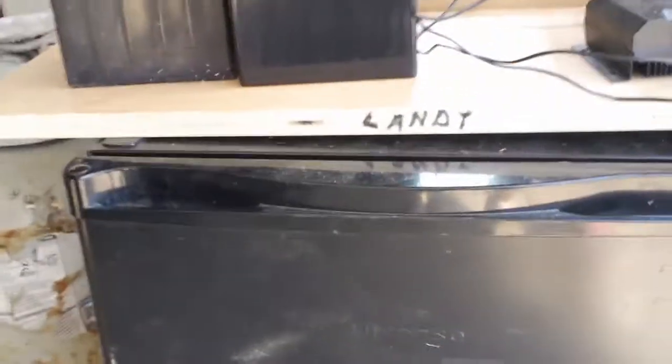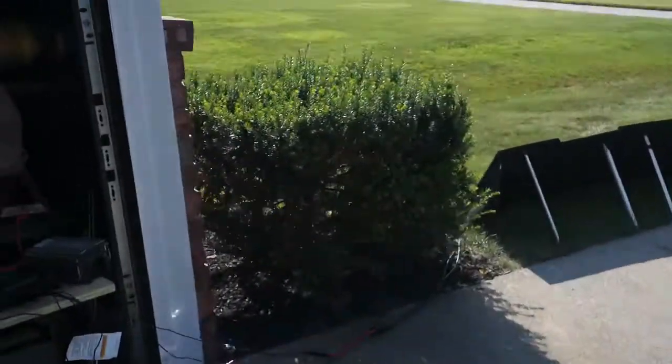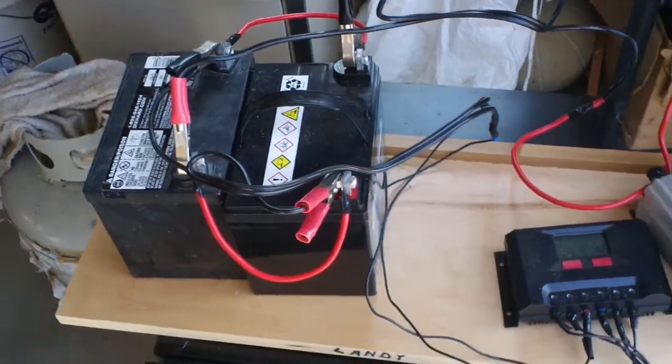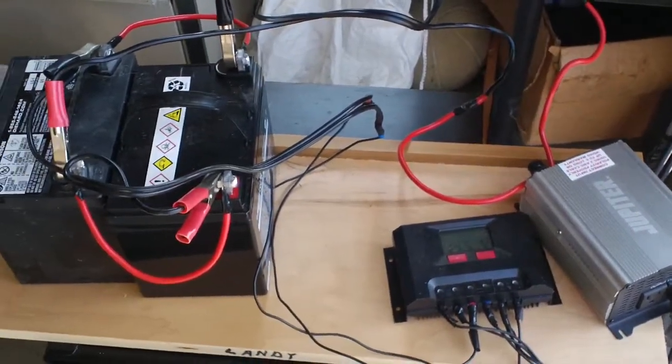I also have the Rock Pals 300 — I used that out in South Dakota and Marquette. When hooked up to this refrigerator through AC, I noticed there's an over-500-watt surge to start it, and when it's running it's probably about 50 to 60 watts depending on your temperature setting. If you're out in Arizona in 100-degree heat with the fridge sitting in direct sun, it's probably going to run semi-continuously.